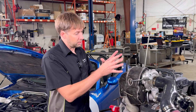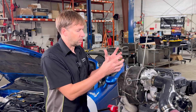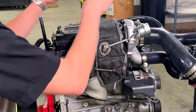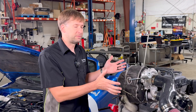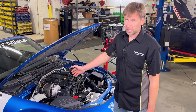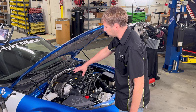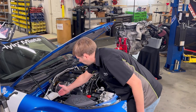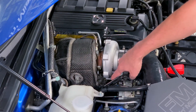The other advantage is that the turbo blanket helps hold the heat in. Holding that heat in means that your turbo is going to spool up faster and the under-hood temperature is lower. So there are performance advantages in addition to simply the safety factor of keeping the heat away from all the sensitive stuff. You can see the turbo blanket installed in the car here — tight spaces, but it gives you good protection on all of the delicate parts: the brake lines, the heater core hoses, and that brake line that drops down right there.